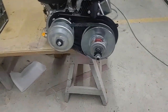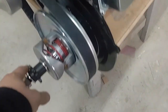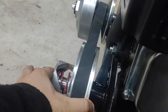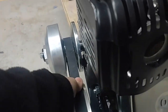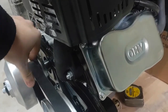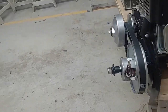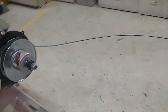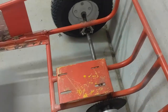I was pondering what was going on with the torque converter. Basically what has to happen is this sprocket has to be on the outside for it to perfectly line up inside. I might have to put a shim or two to get it right — that looks perfect right there, and it also looks good straight. If I put tension on the belt it looks like it'll stay straight, but you have to remember that this comes out and hits this and pushes it over. That's how it's got to be set up. The chain goes around here and sets up on the go-kart like that, but I have to move that sprocket over. I'll put a 35 on it because this one looks a little bent.